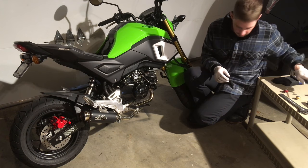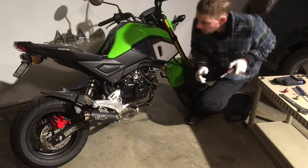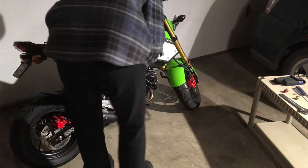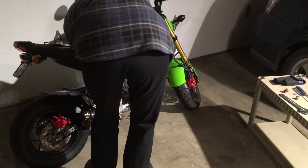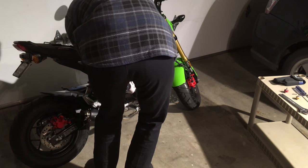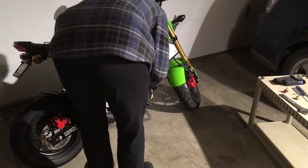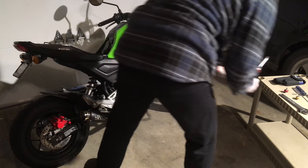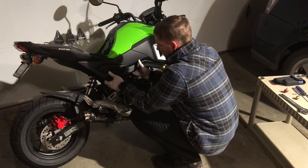I was never able to get the left side entirely off. Under the rear fender, there's three screws. There are offset collar screws on each side of the rear fender. These collar screws are incredibly tight from the factory. I mean, super tight. And the way the chain shroud exists on the left side doesn't allow a normal screwdriver to access the bottommost screw.